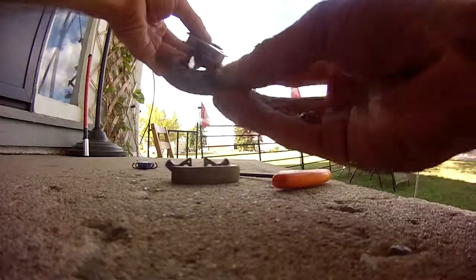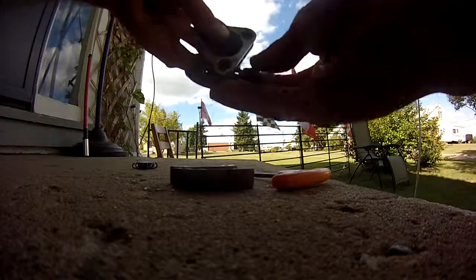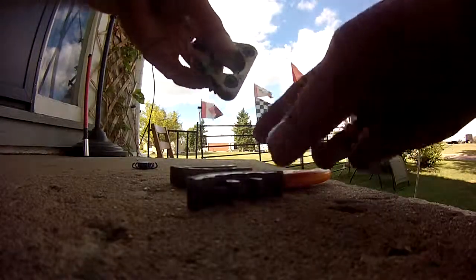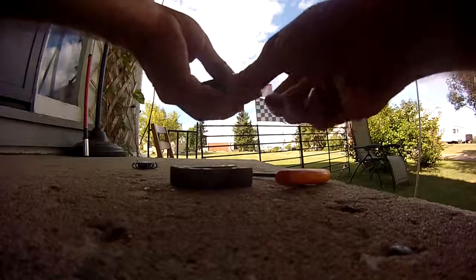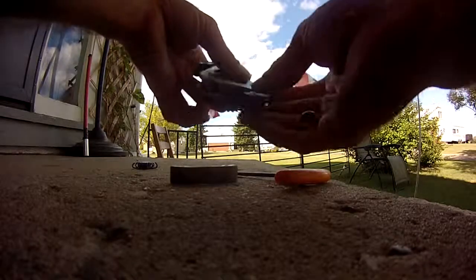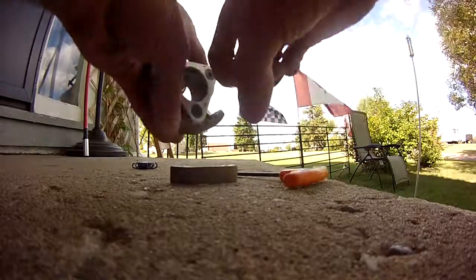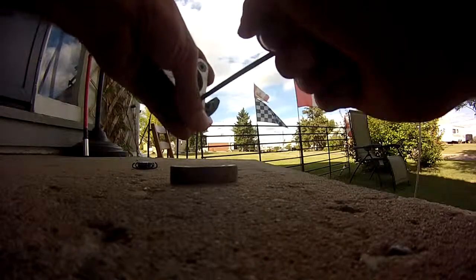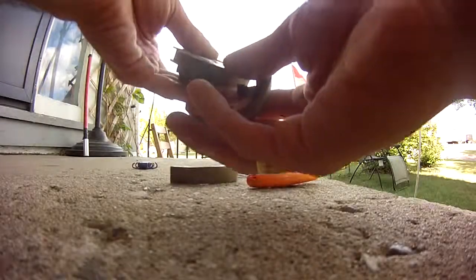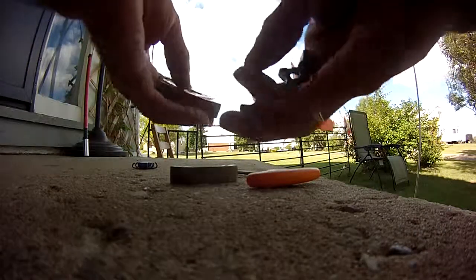And what do we got here? It's number 2, number 1, number 3, and it just slides right out. So make sure that they slide out, make sure they don't stick. Here's number 2, number 1, it's loose. As long as they're not sticking in there, once you've actually tightened down the screws pretty good, you should be okay. But don't let them get stuck in there, otherwise you're going to have some problems, and then you're going to be dealing with ATF and all that crap again.